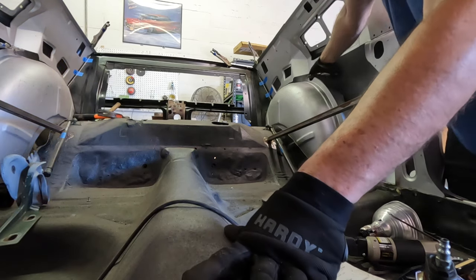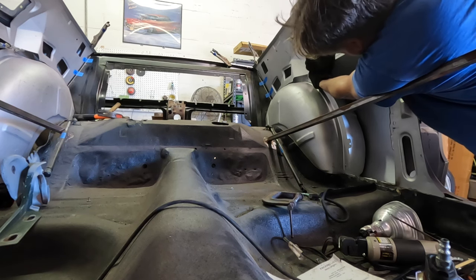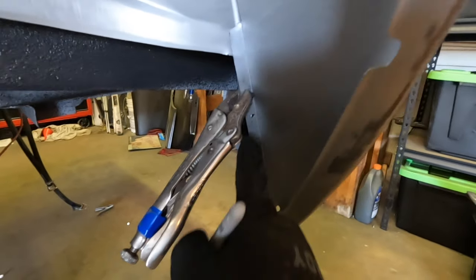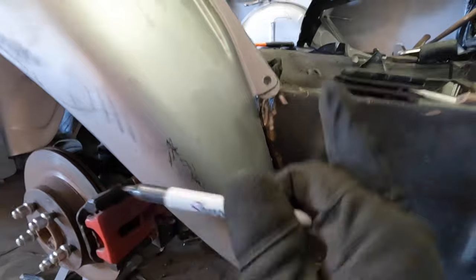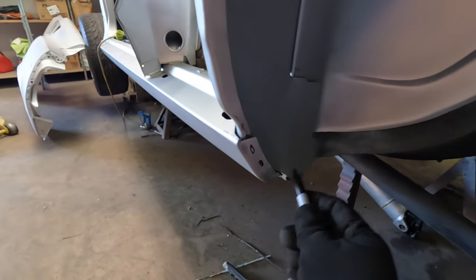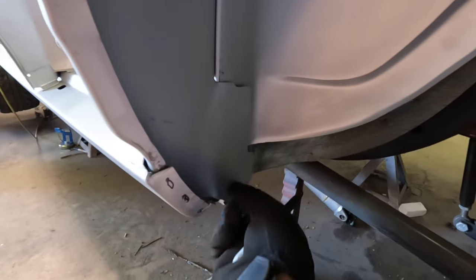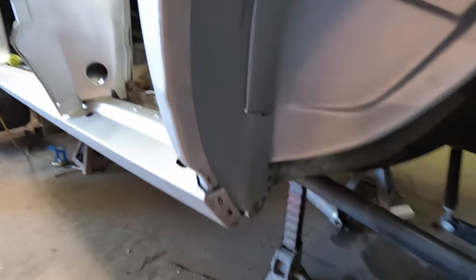I'm making my new clamping in the new location where it's going to be welded. On the inner wheel well there's going to be extra material that we're going to have to trim. I'm taking a line and marking it on both sides of the wheel well so when I take this off I know where I need to drill my holes for my plug welds. I have my holes for the plug welds here and then this flap is going to get welded in there as well.